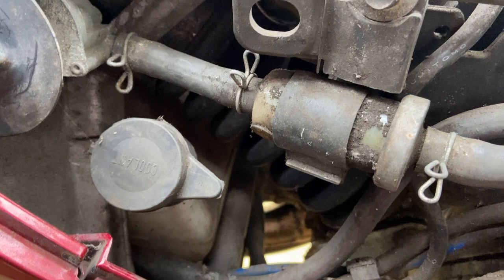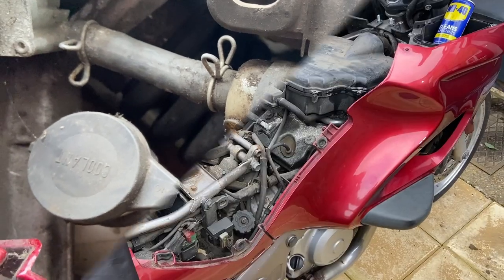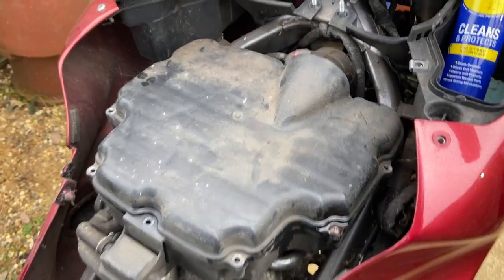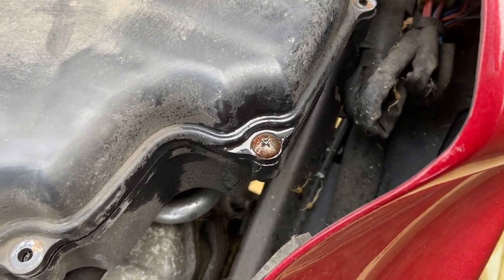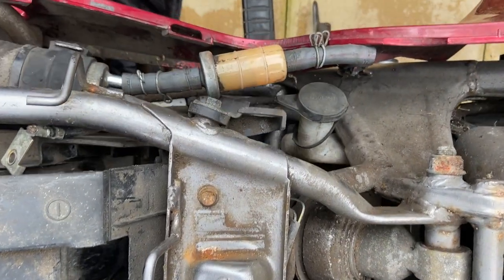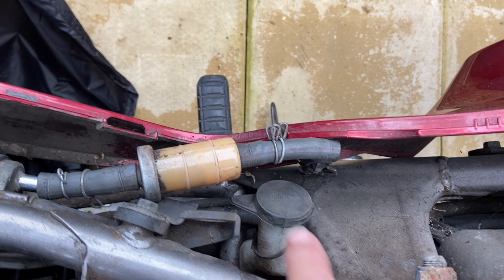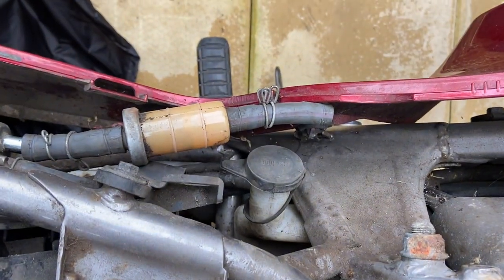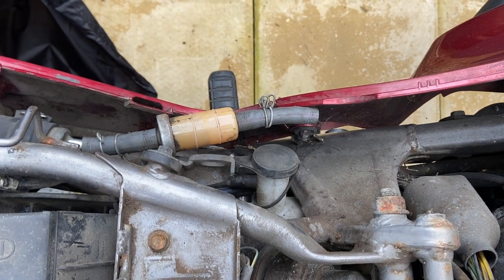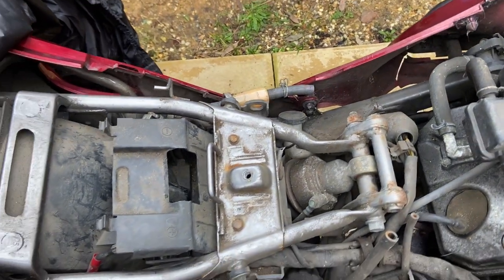The book says just remove it from the clip — interesting, which way up is the clip? Fuel tank off, a couple of the side panels off, that gives me access to the air cleaner except for one screw. I've got WD-40 on that little sucker but it won't move. Looking down the other side you can see the fuel filter, and just below there you can see the cap for the water reservoir — there's absolutely nothing in it. That doesn't bode well. It needs a half water, half antifreeze mixture, so I'll fill that up and see where it pours out.